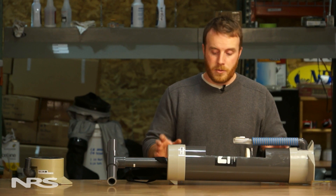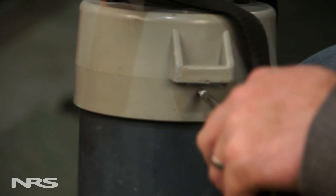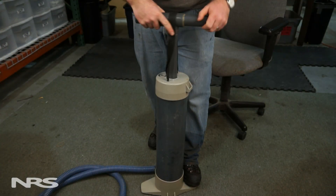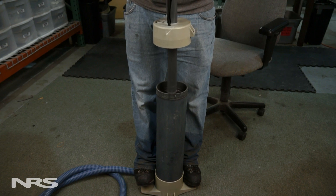To start cleaning your barrel pump it's pretty simple. You're going to want to remove the top assembly from the bottom. Remove any screws you find in the top cap — there's usually at least one if not two. Drape the webbing over the handle, both feet firmly on the bottom of the pump, do a quick up motion, and the webbing will grab the handle pulling the top cap right off.